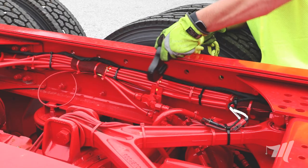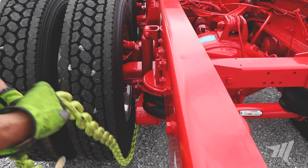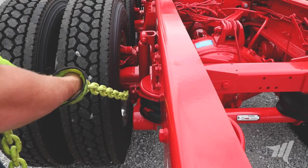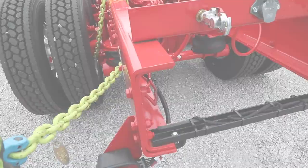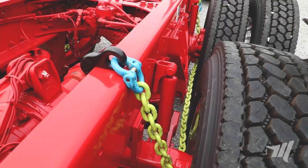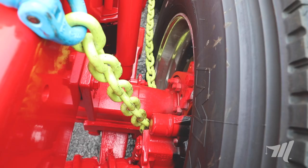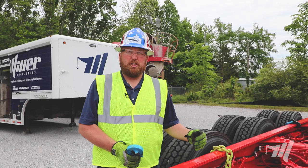What we're going to do here is what I would call long chaining — taking the hook, hooking it above the first axle, going underneath both axles, then hooking it into the chain hook attachments at the back of the frame rail and lifting it up. That way you don't have to worry about stretching out the shocks or ripping the airbags. Some things you definitely want to be conscious about when using this method are brake components, brake lines, air lines, and shocks. You don't want to damage anything while hooking this up, then just repeat what you did on one side on the other side.